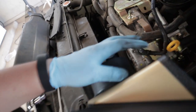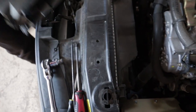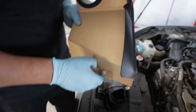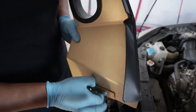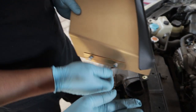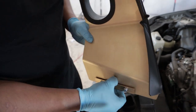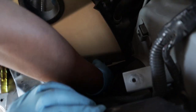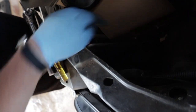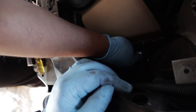There's another piece - this bolt right here is gonna bolt up to this piece with that bolt piece. For the bracket, we're gonna use the screws that they provide and this bracket they're providing. We pre-threaded these in so we're not losing anything when we put them in. So it slips in just like that - basically put it behind this little pinch weld right here, and then you allow this to go over the pinch weld and you're pretty much good.